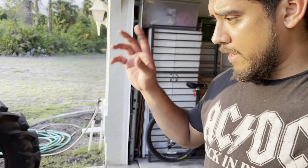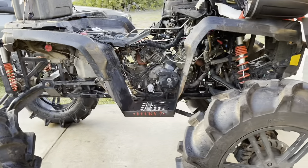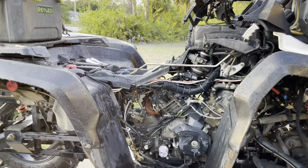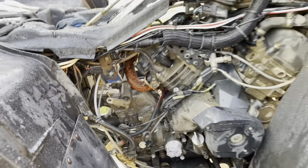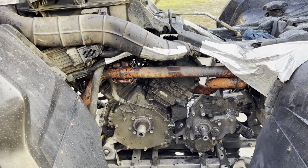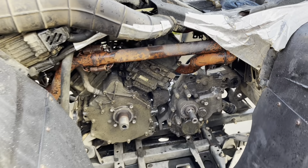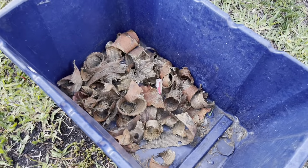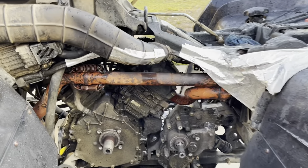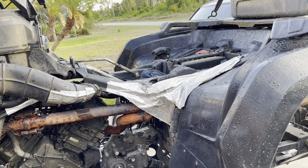What is going on guys — today is the next day. I took the bike out so I could give it a little bit of a clean; you saw how much oil there was yesterday. I degreased it and got it much cleaner so I can work on it better. I also took out the heat wrap that was on it because it was pretty much shot. I think this thing is just running so lean that it burns everything.